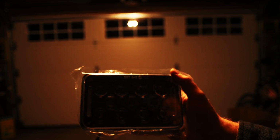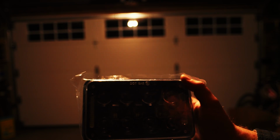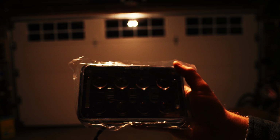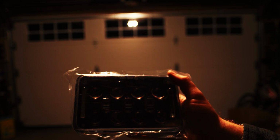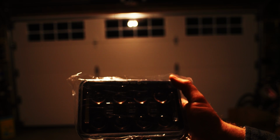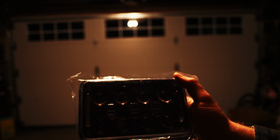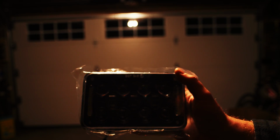All right, one other thing I wanted to mention about the LED before we do the tests. It comes with these driving lights, which have a separate connector. The driving lights actually come on whether you're running low beam or high beam, and also it's important to note that all 4 LED lights are identical, so they both have low and high beam functionalities. So if you wanted more light, I guess in theory you could run all 4 headlights at low beam all the time. And then, you know, just kick in the high beams and blind the daylights out of everyone. But this is what the driving lights look like.